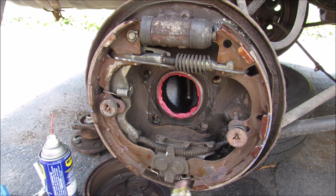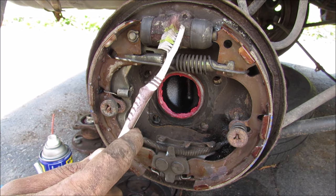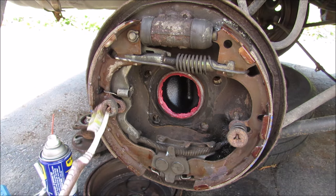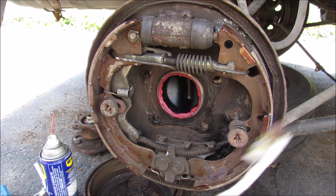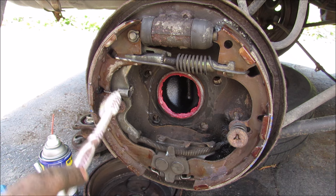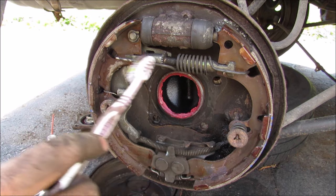There are a few main components that go into this drum brake assembly. We have the wheel cylinder up here, which is your hydraulic piston. We have the brake shoes on the sides to push up against the drum. Then we have these two guide pins that guide the shoes in and out against the drum. At the bottom we have the parking brake cable, the parking brake lever, a return spring, and finally the adjuster for the drum.